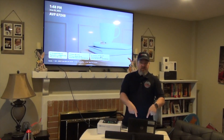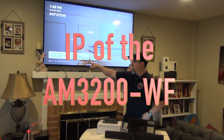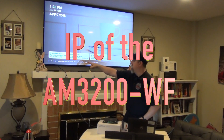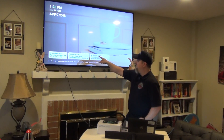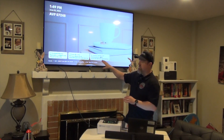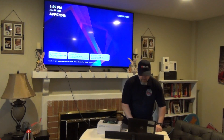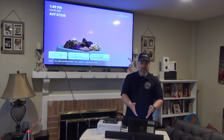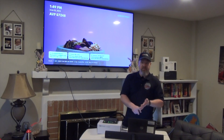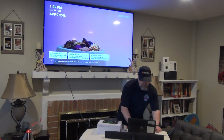I've got the Airmedia application open on my computer. You can see in the bottom left-hand corner it has the IP address of the television, and it also has screen mirroring options for Mac and PC. We're going to go strictly through the Crestron app. Once you open up your Crestron Airmedia app, you'll be prompted to enter an IP address. The IP address is in the lower left-hand corner of your screen, and I'm going to enter that in and hit Connect.